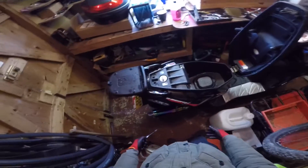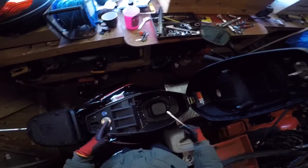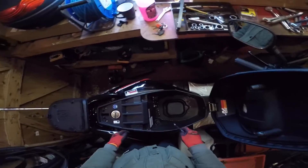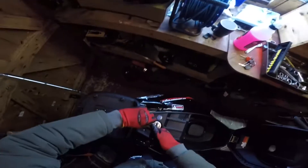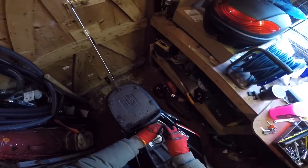I don't know how long this exhaust will last - ideally it should last as long as I have the bike but we'll wait and see. Anyway, the process of locating the CDI starts with your seat bucket. You're going to lift up your seat bucket like so, and then you've got six bolts to remove.